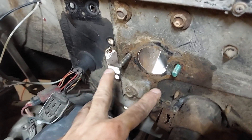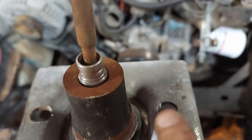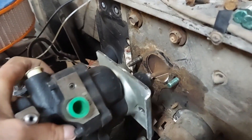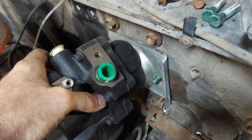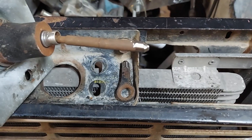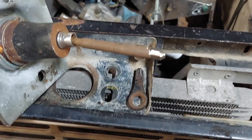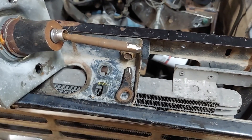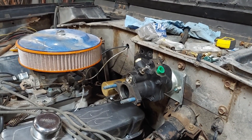The big problem is this pressurized gas cylinder mount gets into my original throttle linkage, so I need to get rid of this whole linkage assembly and come up with something else. I did stumble across one on the internet a couple weeks ago that I had never seen before — it involves using a pedal and linkage from a 70s Ford truck, and it looked like a pretty good fit. I ran a couple of bolts in from the inside just to make it easier to get the brake booster on there. Got the holes egged out with the die grinder — let's see if she fits. I'm pretty happy with that. Shortening up the push rod by about three quarters of an inch — might have to do it again later on when I get it running if I don't like the pedal height.